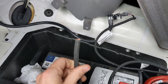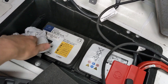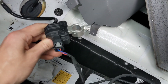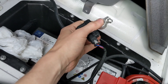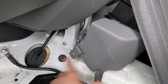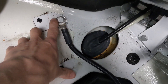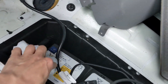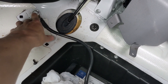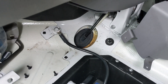We've just run our negative wire through as well. We were wondering how we were going to connect it down to that terminal because on the Sprinter and Crafter there are no extra terminals or studs on the battery terminal we can hook into. I've taken this piece of trim off — just a couple of screws — and that cable earths there and runs all the way along to the negative battery terminal. We're going to use that as our earth point, because if it's good enough for their battery it's good enough for our battery to battery charger.